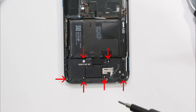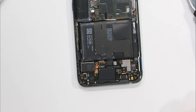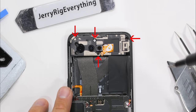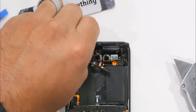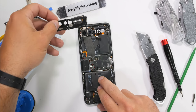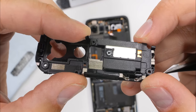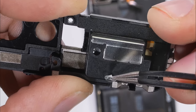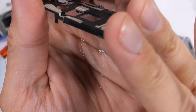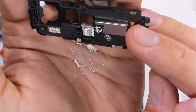I'll remove six different-length Phillips head screws from the lowest portion and the bottom plastics can be removed. The top plastics have four screws, and then the top loudspeaker can be taken out. These stereo speakers on the ROG 7 Ultimate are exceptionally loud, and we can see they contain little white foam balls inside, which gives the sound waves more surface area to bounce off of inside the box, making the tiny speaker sound bigger than it actually is.